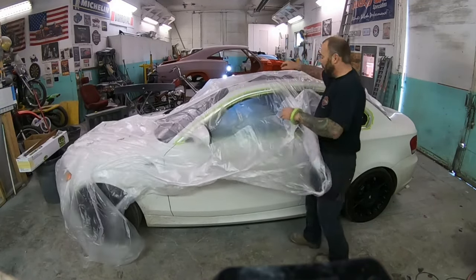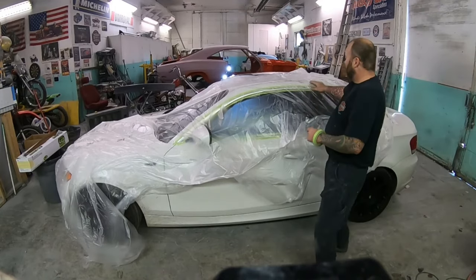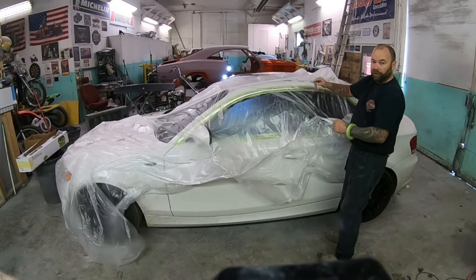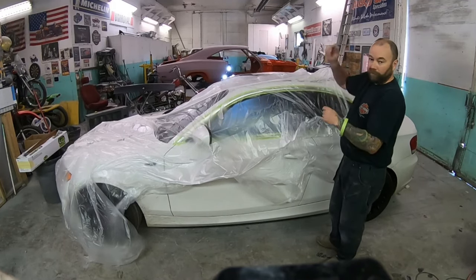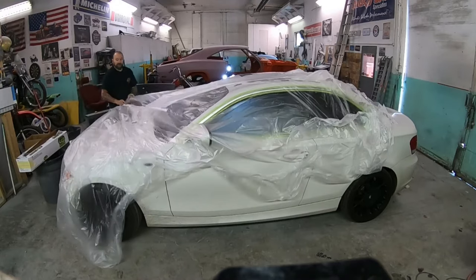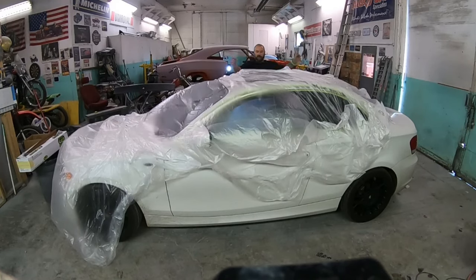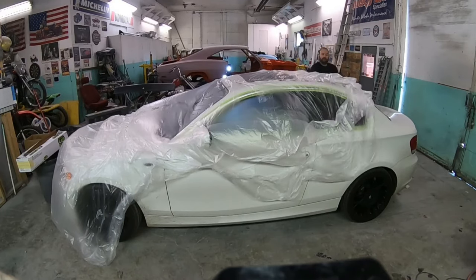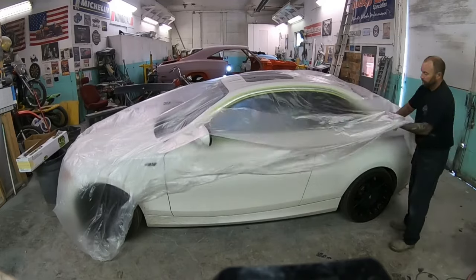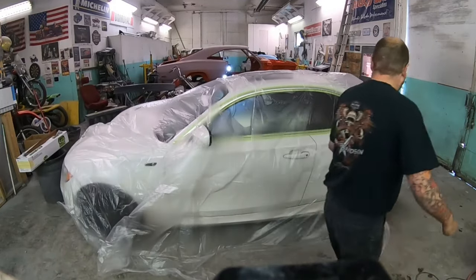Now I'm tossing a plastic over it. Not everyone's going to have this type of plastic — this is automotive masking plastic. If you do use it, always pay attention to where it says 'paint this side up.' If you have that side down, the other side isn't treated so the paint won't stick — you could be painting away and all of a sudden chunks of paint will blow off the plastic. If you paint the proper side, it doesn't happen. If you don't have this plastic, it may seem like overkill but it's not — a little overspray gets everywhere. Newspaper, a couple parts, whatever you've gotta use — cover up the whole car. This plastic folds out to 16 feet, which is overkill for this car but that's what I keep here because I work on a lot of trucks.